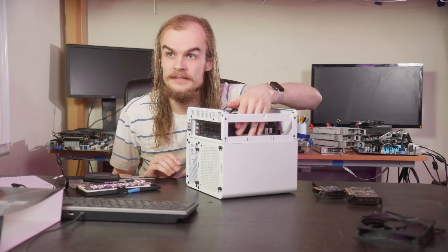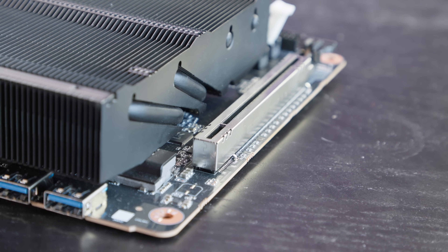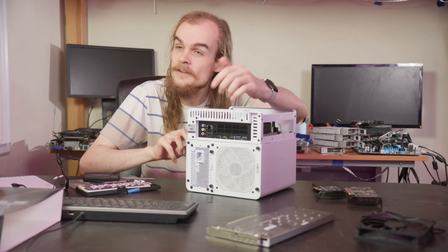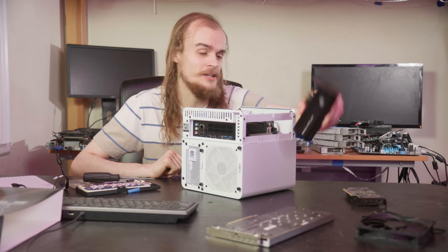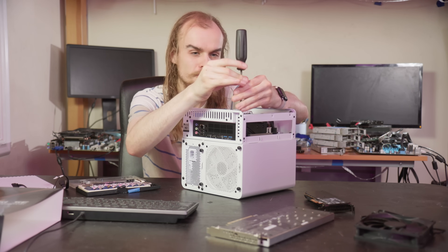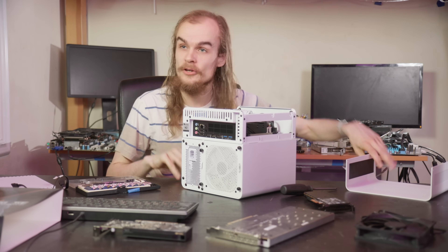That leaves us with the PCIe slot. I like PCIe slots on these systems because they add a ton of flexibility — I could put in a 10 gig NIC for faster IO, or a card with four M.2 bays since this board supports PCIe bifurcation in the BIOS, which is a cool feature to see on a smaller board. Or I could put in something like an Optane drive, or even a GPU like this Nvidia RTX A400, which is a low-end pro-grade card with pretty decent encoding capabilities.